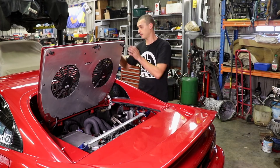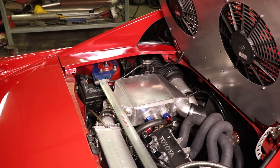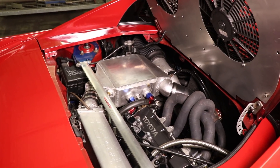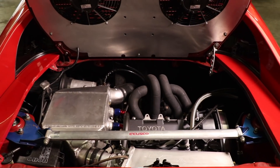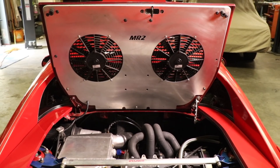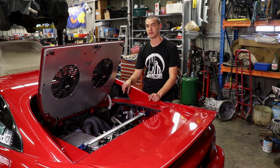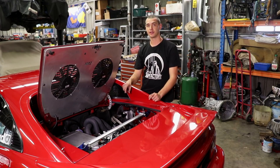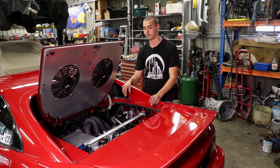Basically it's a front-wheel drive layout brought to the back here. The Toyota 3S engine was used in a lot of different cars — the 3S-GTE came out in the MR2s, the GT4 Celicas, and the Caldinas. There are lots of different generations and variations of these motors, all the way up to the BEAMS, which is a non-turbo with variable valve timing. This engine itself is a generation 2 standard block. A lot of guys will upgrade to the 5S block, which is apparently stronger.